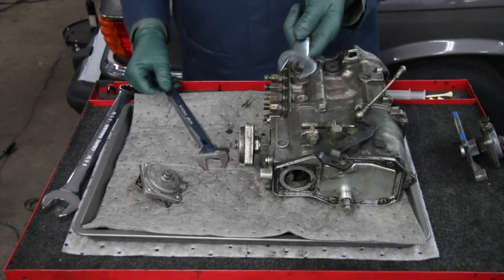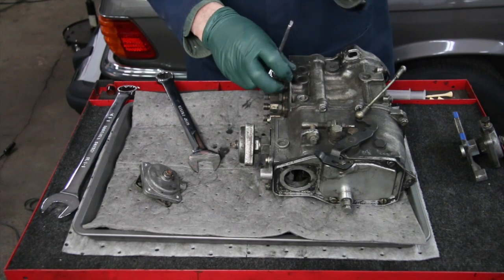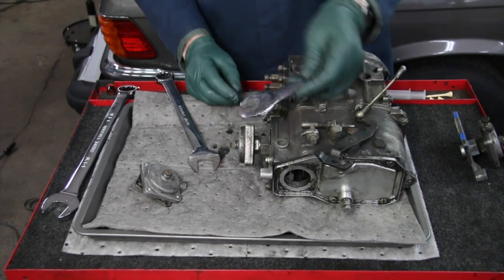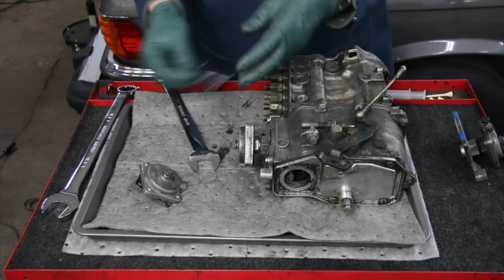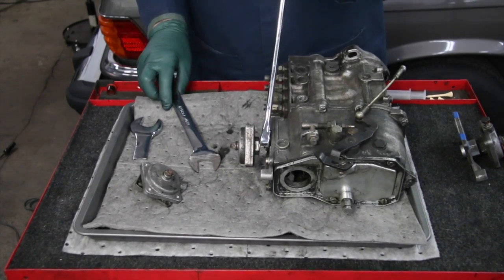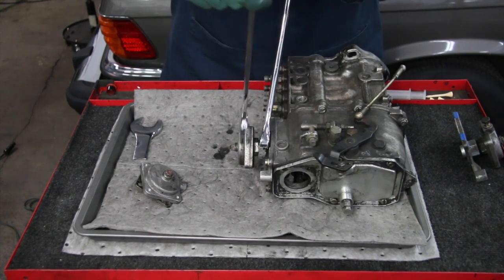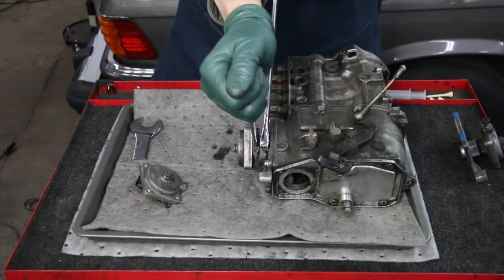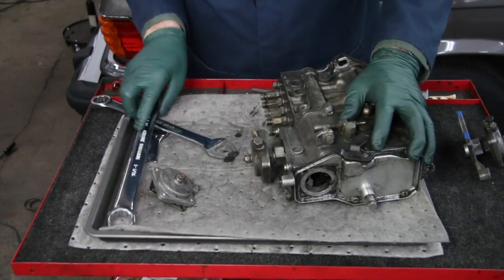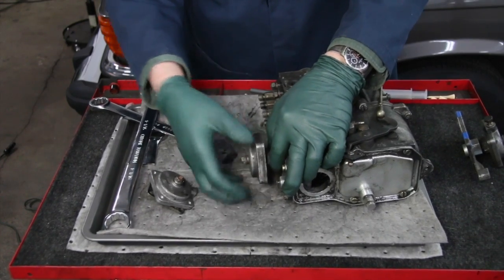And then this is the short end that we include in the kit, and this will go on the big one. Now if you only have this wrench, you're going to need to get a pipe or a vice grip or something to get a little more torque on this, because generally you can't loosen it just with the short piece that you have there. So I'm just going to take another 1 1/16 inch wrench that we haven't modified yet and show you how this comes off. So I'm just going to work this wrench down inside here, get on that, and then I'm going to torque it that way. And then this is going to turn off by holding the big nut and spinning the ALDA off like this.